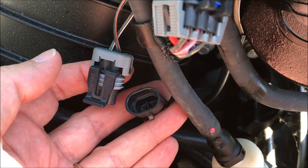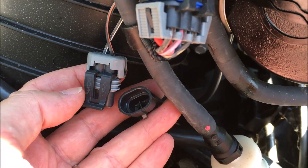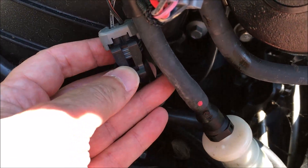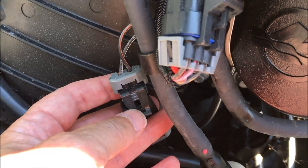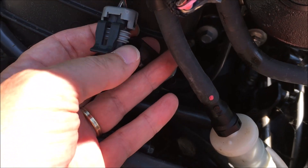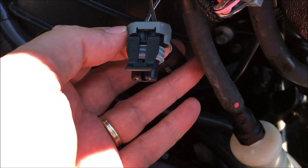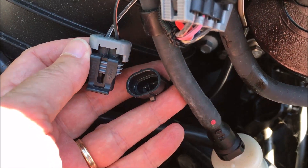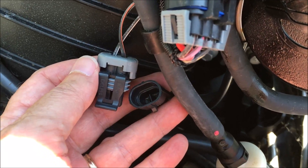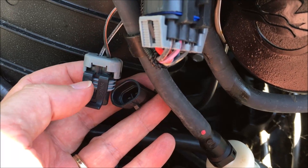This is an easy way to test it — unfortunately I tested this after I replaced my spark plugs for $50, but anyway. If you get a similar issue, I would personally start the engine with the switch connected so you're sure to be starting in neutral, but once it is started you can disconnect it, because it basically just opens the loop and the motor will think it's no longer in neutral. That solved the problem for me, so hopefully this will save somebody else a lot of trouble. The rest of my videos will be going back to 3D printing — thank you.